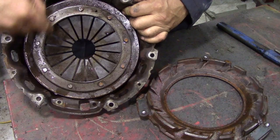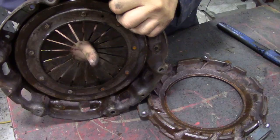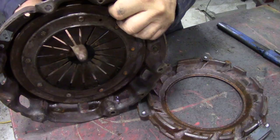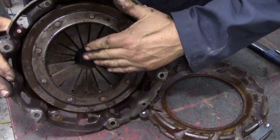It's a big round fulcrum — just think of it like a lever. So when you put your clutch together, these fingers will be all flat. But when you put pressure on by pushing your clutch down, these fingers will go inside and these will retreat. So when they go in, that goes back, and that releases your clutch — and that is all there is to it.